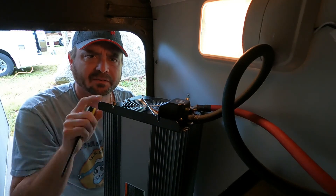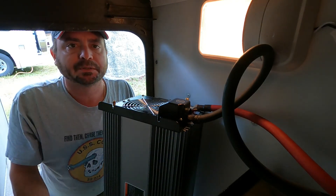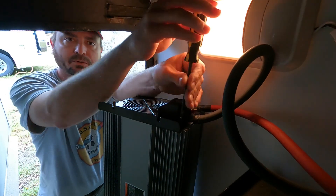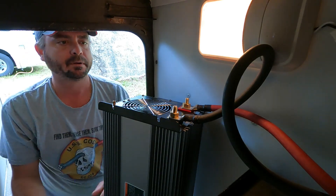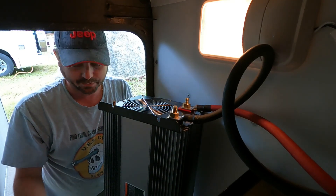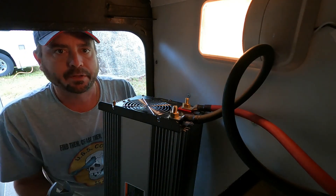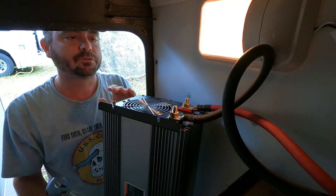The ironic part is this inverter has a lot of good reviews on Amazon, and I've gone over my installation several times to make sure I'm not doing something wrong. I think the only thing I might be doing wrong is allowing it to run while the alternator is charging the batteries, because the instruction booklet says don't charge the batteries while using the inverter. We had been running this inverter while going down the road so we don't have to run the generator, and I'm thinking maybe that's causing the issue. I've got another solution for this inverter — I'm going to install a transfer switch to switch between the inverter and shore power automatically, while still giving the generator priority.